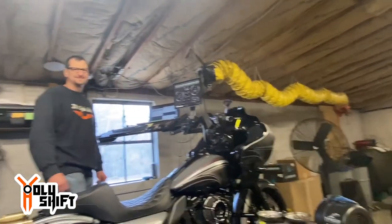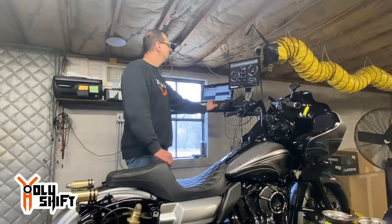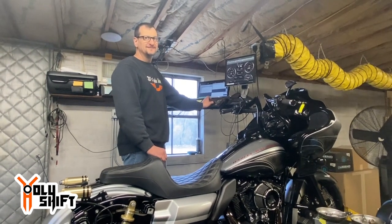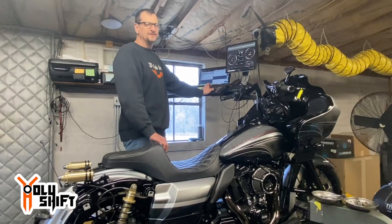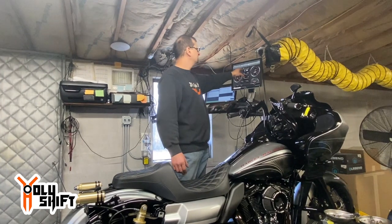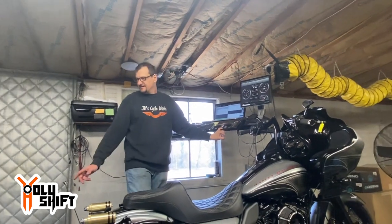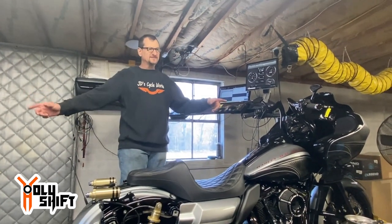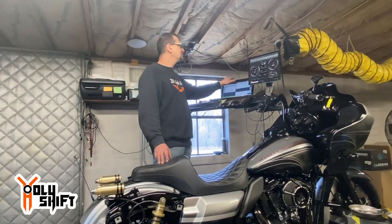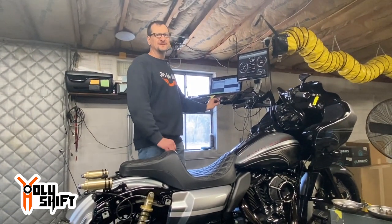So explain to me, when it was showing 200 foot-pounds of torque, what is that? It's not the current reading of the... That is what the machine is telling me it's seeing in torque. But that's not what you're going to calibrate it finally. Well, no, when I calibrate the torque control, the load cell thing. I'm mixing my words up. It happens. I have a bar I put on my eddy brake. It's a big 5 or 6 foot bar somewhere around here, probably in the corner. I hang those weights on there and I zero it out. So that is telling me exactly what it sees for the torque.